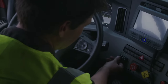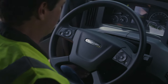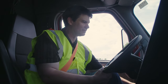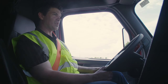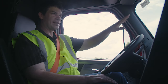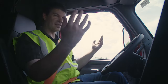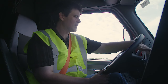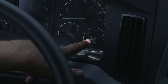I'm going to perform a safe start. First, I'm going to put in my alarm code. I'm going to turn the key to the on position and make sure my ABS lights come on and off. Make sure I'm in neutral, apply the brake, and start the engine. I'm going to check my windshield and mirrors — make sure they're properly mounted and secured, not cracked, bent, or broken, they're clean with no obstructions, and my mirrors are adjusted to me. I'll check my voltmeter: the alternator is charging between 13 to 14 volts, my oil pressure is rising up to normal operating range, and my water temperature is rising up to normal operating range.